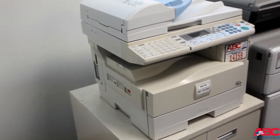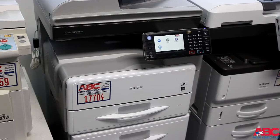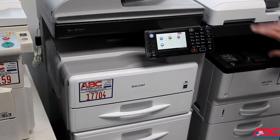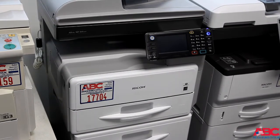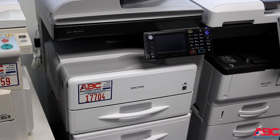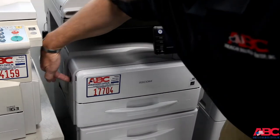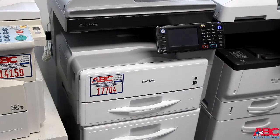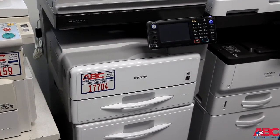Your unit is now completely shut down. To turn the unit back on, go back over to the switch and turn the unit back on and it will restart. On the current Ricoh mid-generation units, this is a two-step process. First, we want to go up to it and hit energy saver. This is not completely shutting down the unit. Once you've done this, go over to the side and there is a black button right here. Turn that off and that completely shuts down the unit. To turn the unit on, flick the switch on and the unit will be rebooted.